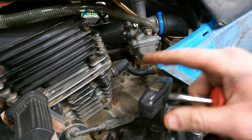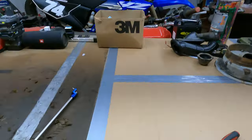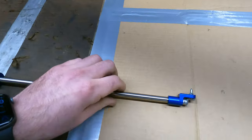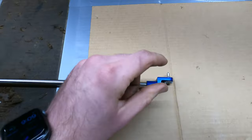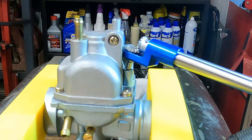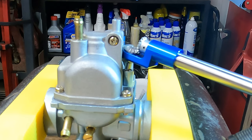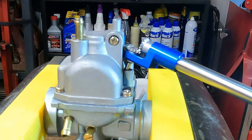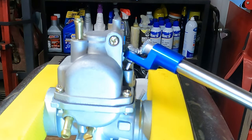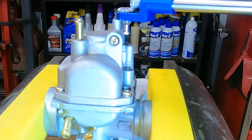I don't need to move anything except for the recoil handle — that was the only thing in my way. I'm excited for this tool. The other thing I didn't know about was they offer a part number for one of these bits but it's an inch and a half long — I would probably recommend that. I kind of have to hold it at an angle in order for it to actually hit that screw, so it actually bound up on me a little bit. I really think buying the longer one would be better because you'd be more straight on top of it.